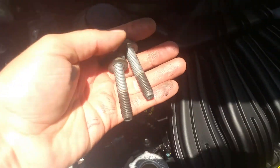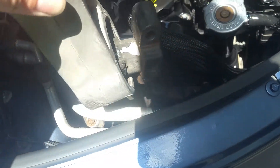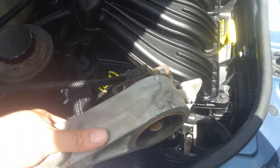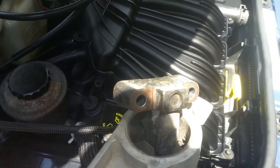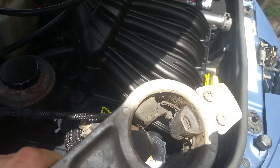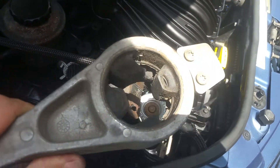Here are these two bolts — the 15s. We've got those out of there. Now, depending on yours, you usually can wiggle these out. I like to flip it down like this and just try to wiggle it right up through here. Some are different because some of those AC lines are more over. And we can already see that this part — we couldn't tell it down there — but it's falling completely out. So that's not good. The motor can move around quite a bit.